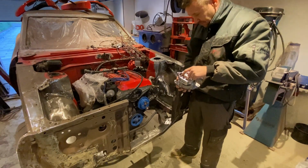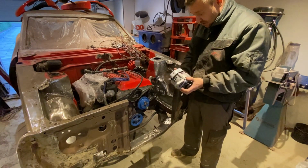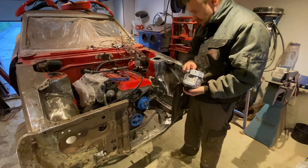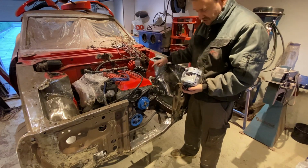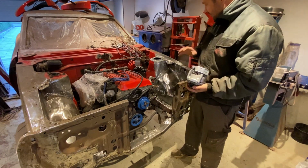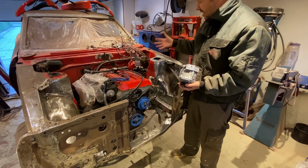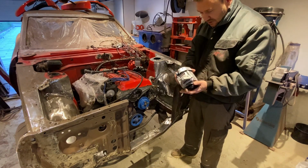We do need to order some plugs to start making the new harness. This has a built-in regulator and these are commonly available, so if they blow you can buy a new one for, I think, about $100, something like that. We are going to be running the power lead of this in conjunction with the main lead from the battery in the boot, all the way up here, and the starter, which is going to be all three connected and from there chained into the main harness. So we have all the main power consumers and makers connected by pretty big cables, and then we kind of go down in size as we go in the car. And we're going to be connecting up with fuses, a fuse box, a relay box, all kinds of goodies,